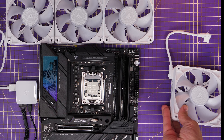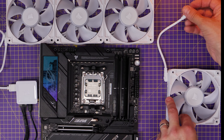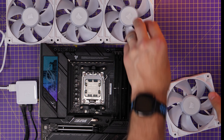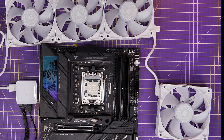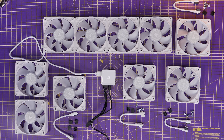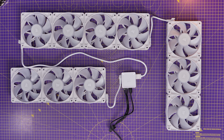For example, if you use a fan as an exhaust at the rear of the case, you can connect one cable to it and then the other cable connects up to another group of fans, which in turn connects up with a longer cable to the controller or to the all-in-one cooler. It's really easy to daisy chain these things together, and you can have up to 12 devices on one side of the port.